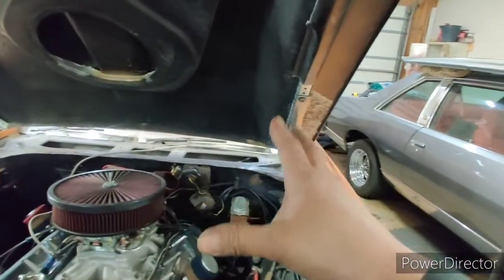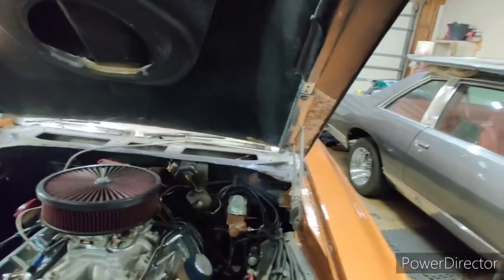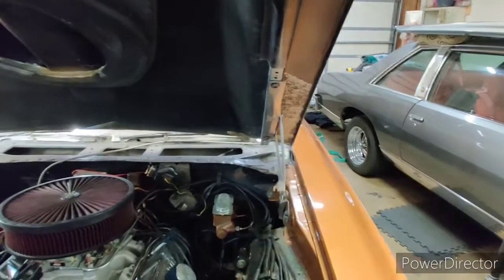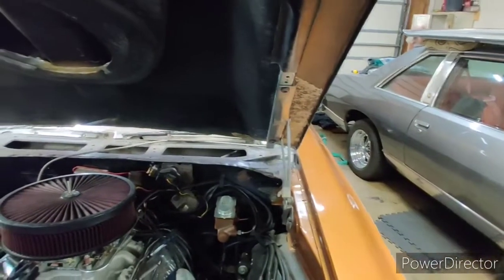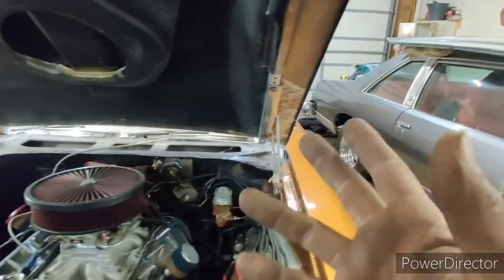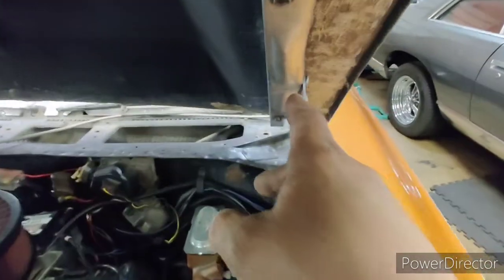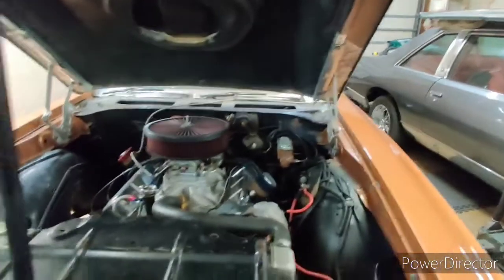I know that I'm good where I chose to put my hinges. Now, I am going to end up opening up not only the front of it, but the back of it, because as you can see, my hinges are kind of tilted. Well, inherently in the process, when I measured everything, it kind of shrunk a little bit, so I did have to pull the hinges in. So that's why this hood is a little hard to open as well. These hinges are worn out, and you can see these pins are pretty worn out, but I'm not worried about that.